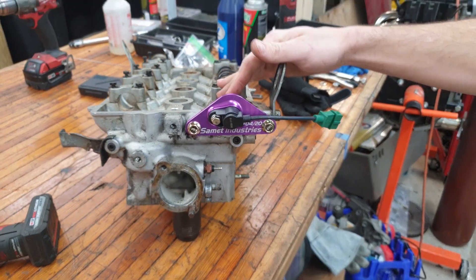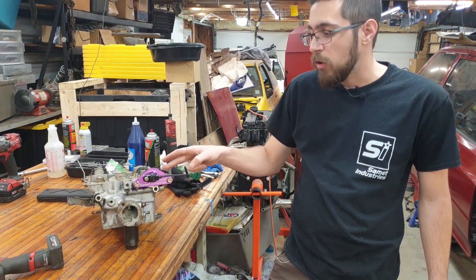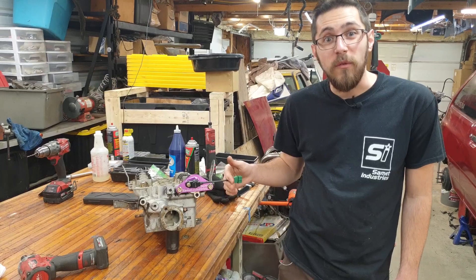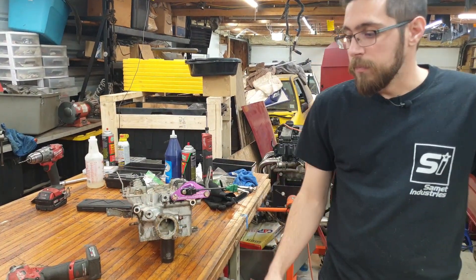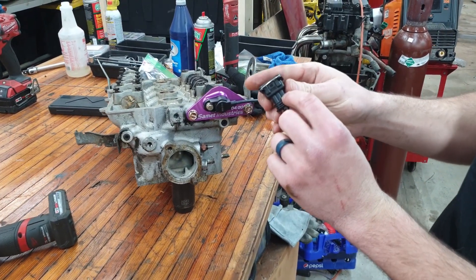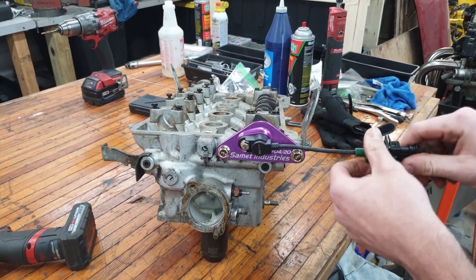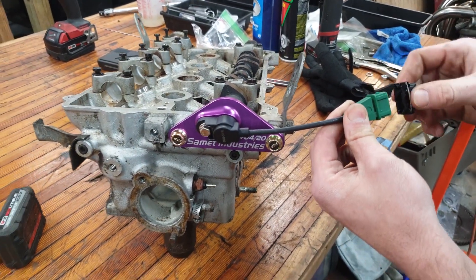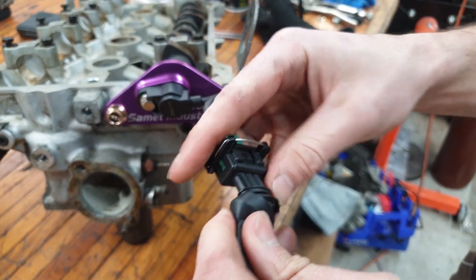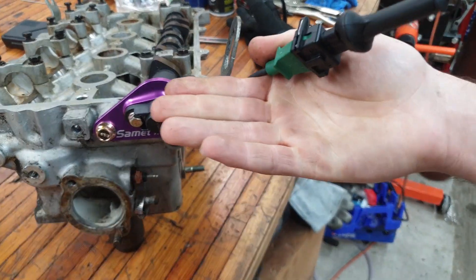And there we have the sensor kit fully installed - that's all you got to do. Once you have your hole drilled and the dowel is in place, at five millimeters we have plenty of clearance for the sensor. This is a hall effect sensor - it'll have no problem at low speed or high speed. Since these are OEM, they're very reliable. These come off of a Hyundai or Kia 2.5 or 2.7 liter - a newer engine - so they're really easy to get at part stores if you ever need to replace it. The part number is also on the bag. For wiring, there's a list on the product page, but as a reminder: your connector is numbered one, two, three. Pin one is power - it's a 12-volt sensor. Pin two is ground. Pin three is signal. These connectors click in and press to unclick, super easy to get on and off. We're also including fancy boots that go with the connector - once you get your terminals in and wired, you can close it in place, get your boot on, and end up with a very professional looking installation.